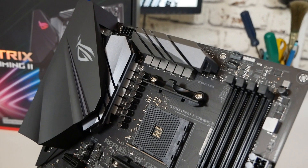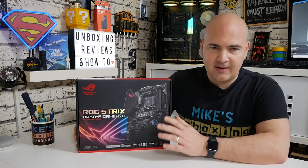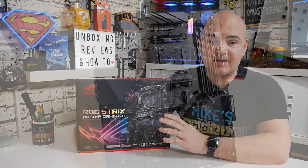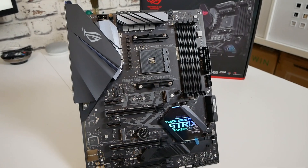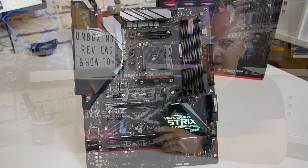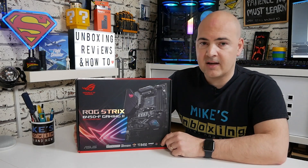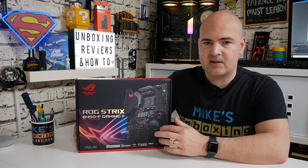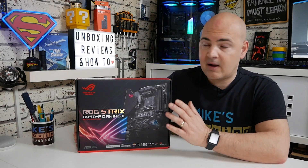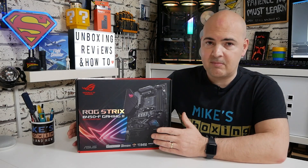The actual physical weight of this board is pretty hefty — it is a very heavy board. Some things which may be slightly more important than colourful lights is the memory capacity. They've doubled it: the previous model had a top spec of 64GB, whereas this will now take up to 128GB over 4 sticks of 32GB. They've also upgraded the memory specification in MHz, now topping out around 4,400 MHz, which for a B450 board is pretty awesome.